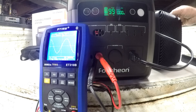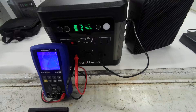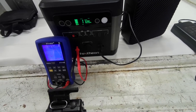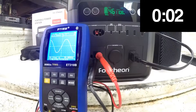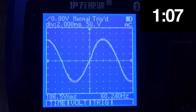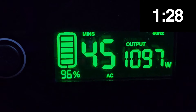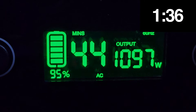Let's do fan only — that's 2 watts. Heat setting 1 is 465 watts. Setting 2 is 695 watts. Setting 3 is 1100 watts — well, it's rated for 1200. It's saying 45 minutes of runtime. There is a little bit of variation in the sine wave, a little noise, but it's pretty clean. According to the battery size, you'd expect about 45 to 50 minutes, so it's about accurate.